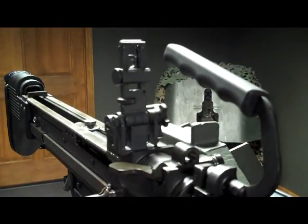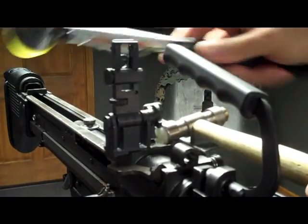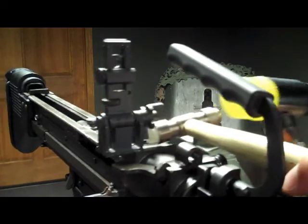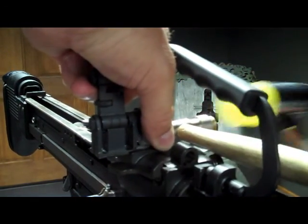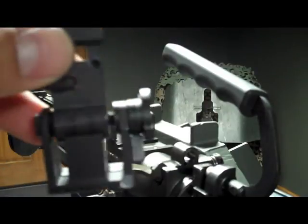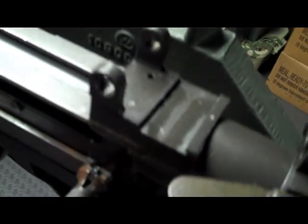We can see it's coming out of there — we can see it coming out the side of the trunnion. Give it a couple more hits. You want to make sure you're hitting it straight out, not going on any type of angle. We're lining our fiberglass tool up so it's going straight out the side. A couple more hits and there it is. We can see our beveled edge right here — it came right out the top as it was intended to do.